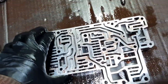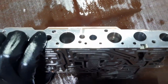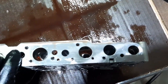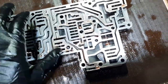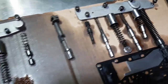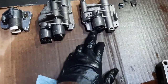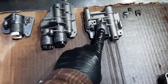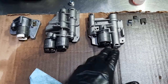Other than that, you really need to be organized. You need lots of brake cleaner on hand — I really mean it, clean everything, all the bores, everything. Don't use steel wool or anything like that in there. Just use the power of brake cleaner from the can, then clean everything and make sure there's no oily dark residue from over the years. You want to get rid of all of that. For the solenoids, you want to test them to see if they click.